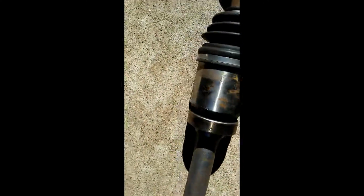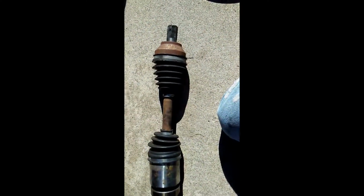Not sure how much play this is supposed to have, but I'm relatively certain it's less than it actually does. I can definitely feel the shaft moving inside this rotationally. Just a bit of a fraction of a millimeter of movement, but that's probably going to be enough to cause the symptoms I'm getting, which is a pretty healthy shake. Not dramatic, but enough to be annoying.